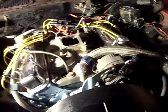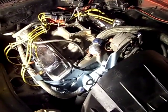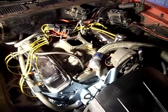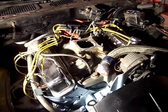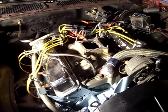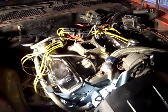It did clear up a little bit. It was definitely running rich. I did adjust the idle — I'm actually at one turn out. However, it was still running a little rich, smoking out the back, and I couldn't get rid of it. Kind of stuttering, stammering. So I went to set the float level after I set the idle, and lo and behold, I had the adjustment screw all the way in and the fuel just kept running out. Let me show you why that was happening.